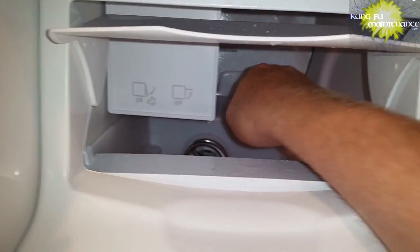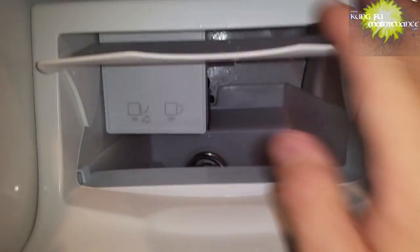Moral of the story is if the water from the ice water started tasting bad, it's probably time to change out the ice and start fresh. And on a side note, if you're hooking up a new ice maker, you want to dump the ice for like the first 48 hours to make sure that everything in the line is clear. That can also not be a healthy situation for a new ice maker hookup. Now I have fresh ice, and the water will taste good again.